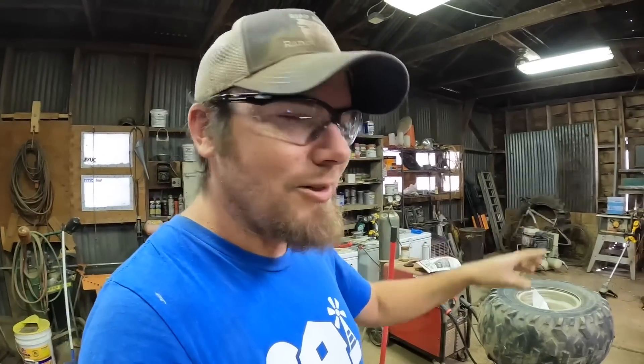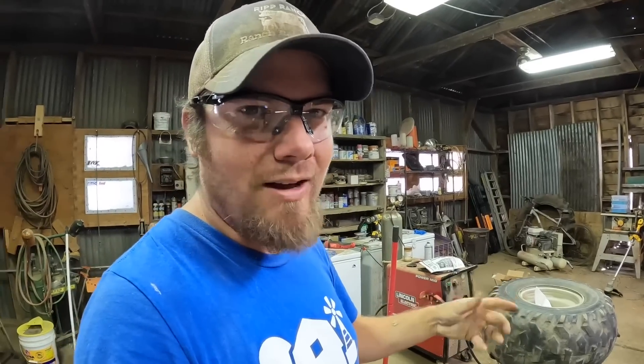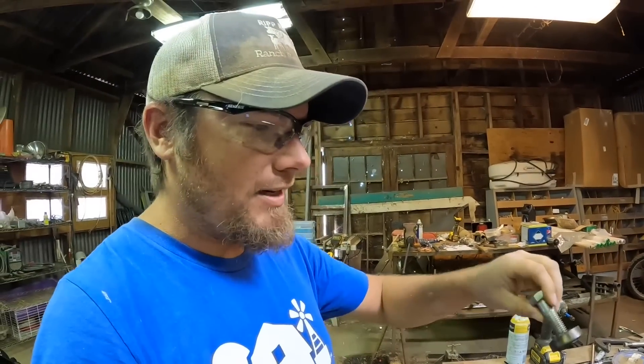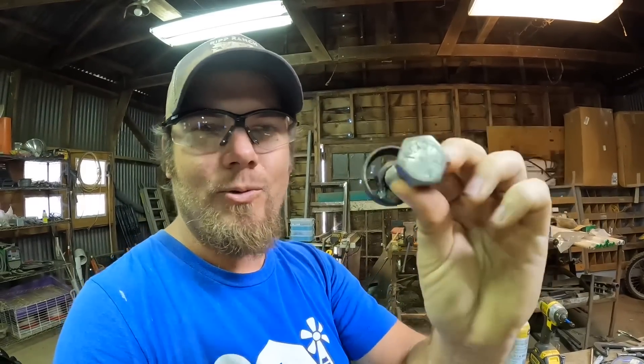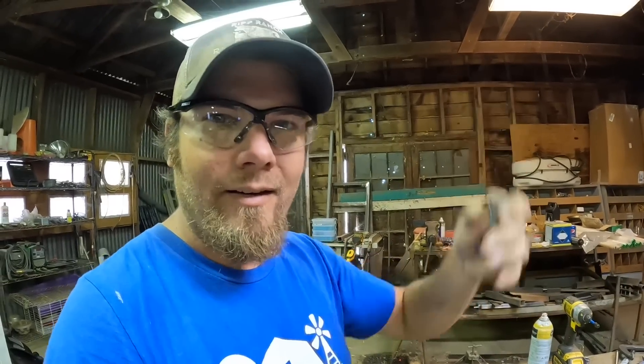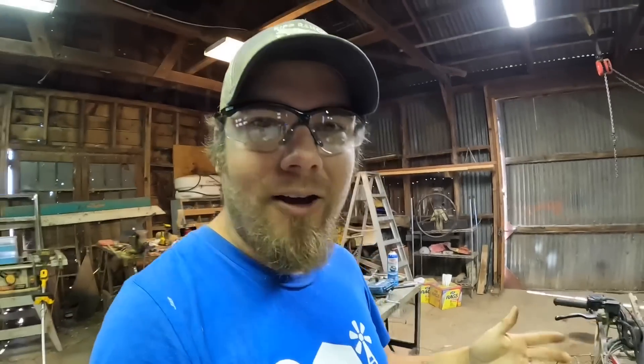The other day I got a little over-anxious and pulled the old bearings out of the swing arm without a camera — it was just one of those things where you get going and forget everything else. It's pretty self-explanatory; pulling old bearings out isn't much to it. The only noteworthy part was getting the old races out. What I ended up doing was welding a nut to the old race and then threading a bolt in to pull them out that way, because they were stuck in there.